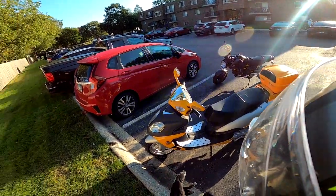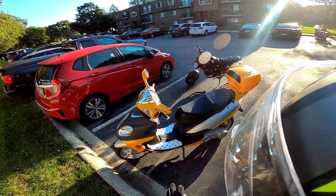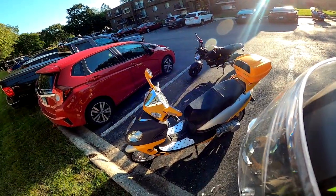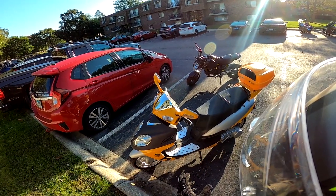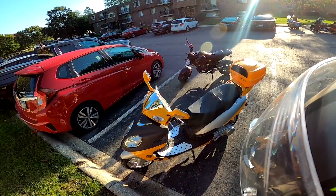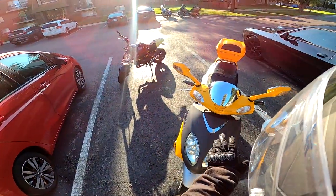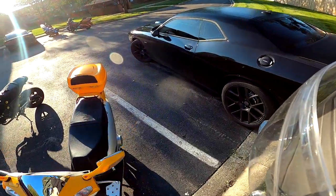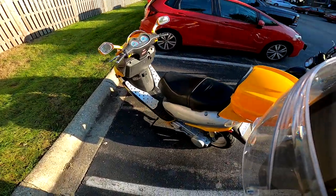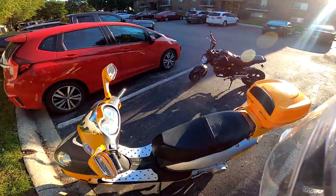What's weird is it's only the headlights and something else — everything else is off the 12-volt system. There's a separate winding on the stator for the starter, and then there's a separate winding or two for other electrical. We could bypass that, and I want to get some LED lights — we could definitely put some LED lights up front, and get an LED bulb for the back. So really, to me it's the brakes and the electrical so you can ride it at night.